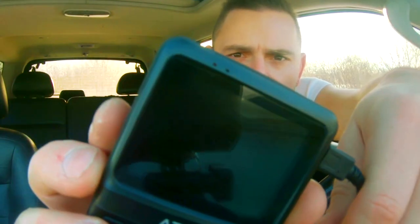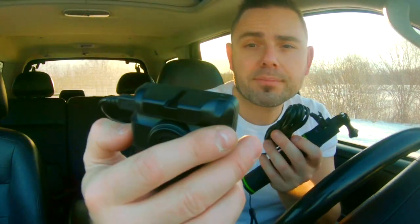At the very bottom it's showing you the date and the time that it's recording. Your power on and off button is right here, and you have two little lights which are green and red. This camera does have lithium-ion batteries. The thing with lithium-ion batteries is that they are not as good in hot weather — they're going to discharge. It's not a very reliable thing to have lithium batteries on devices you're trying to rely on when recording. Right now the camera is connected to an external power bank and is charging — it will take about 120 minutes or two hours to fully charge. That little red light indicates it's actually charging. Once fully charged, you no longer have to rely on the connected power, but it's quite recommended that you always have this plugged in and rerouted through your car wiring.